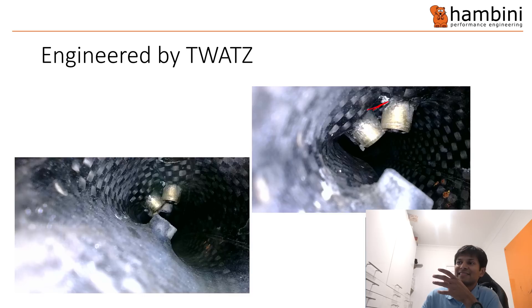The stress raiser is there because the inserts are close to each other. You screw from that side and from that side, and what they try to do is force each other apart — you're going to get a crack. I do quite a lot of insurance claims, and one thing you look at is failure by design versus failure by manufacture. This would be a prime example of failure by design, because these appear to be the original parts. If you get a crack in that region and it causes a catastrophic failure, BMC will be all over the coals — I don't think they have any defense.